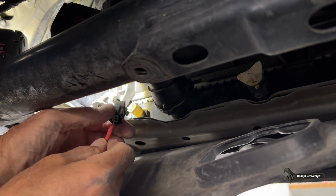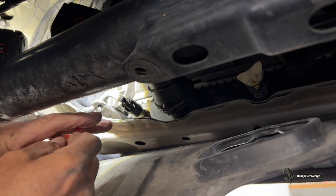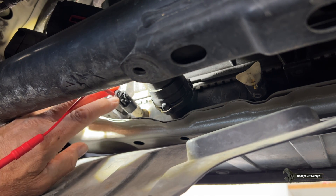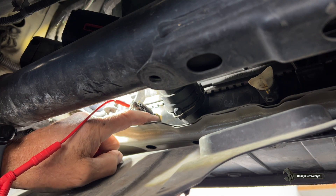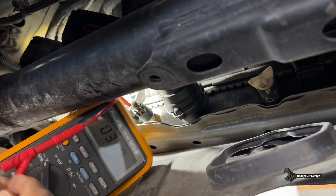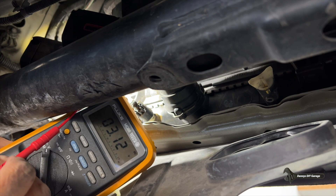What this circuit does is supply five volts, then it goes through the sensor to ground, and whatever voltage remains the computer reads. Next, I'm going to back probe that five-volt reference wire and plug the sensor back in. Now that five-volt reference is going through the sensor, which is a thermal sensor, and it's losing some of those five volts as the computer reads it. Right now the meter is reading 3.19 volts. When that gets down to about 0.5 or 0.6 volts, the fans will come on.